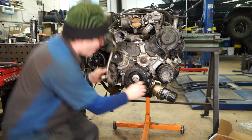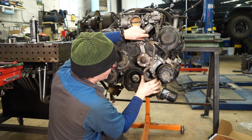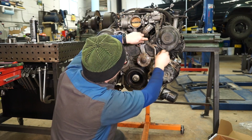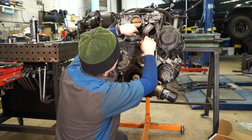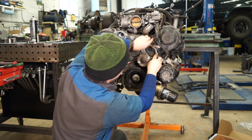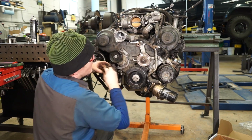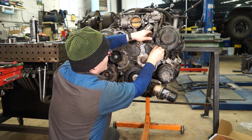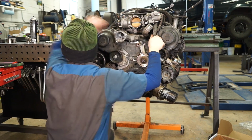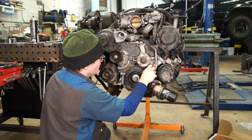And we can put our water outlet pipe back in here. If I can remember which way it goes around. And just switch its hooks on the cooler there. Kind of tucks behind this wiring harness. And then onto the water outlet there. And then it goes over the stud coming through the timing cover with this little 10mm acorn nut. And stick that hose on there too. And then there's a little bolt down here that goes into the fan bracket.